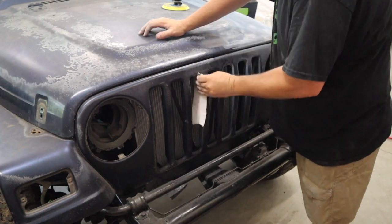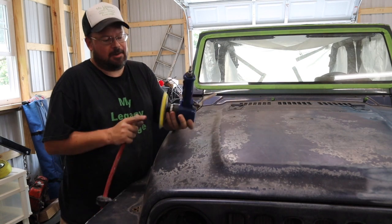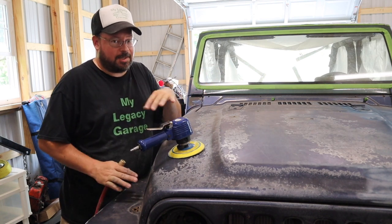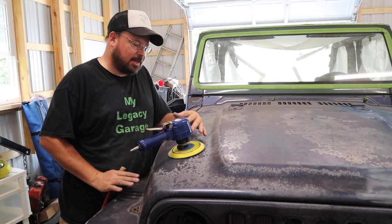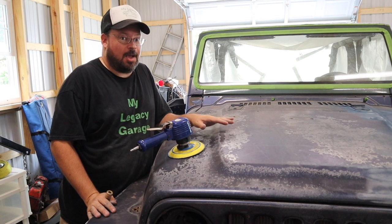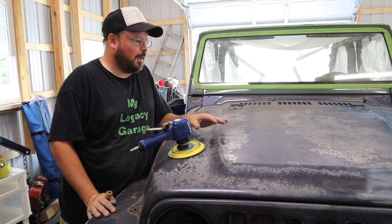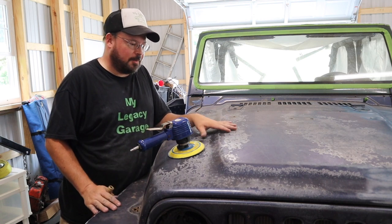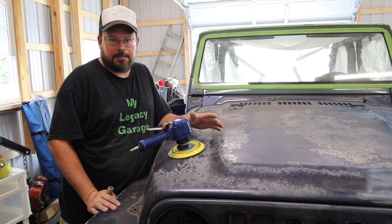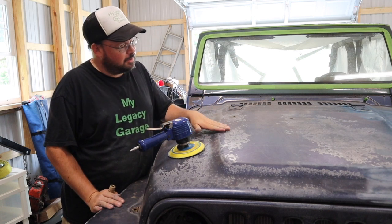If it was easy, everybody would do it, right? What you can sand with power tools, you do, because it's a lot of work. I've got a DA sander here with 80 grit on it. I always sand the first pass in 80 grit and take everything down, then go over the whole thing again with 220. That gives it a fairly smooth surface. Then you clean it all up, wash it off, wax remover and degrease it, and then you can prime it. Give the primer a light sanding with 220 to smooth it out, then prime it again to build a good surface so you don't rub through it easily. Then sand with a really fine grit — probably 400 — sand the whole thing dry, then wet sand it until it is smooth as glass.